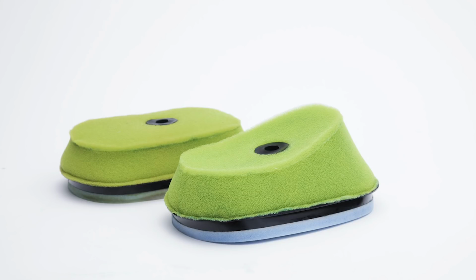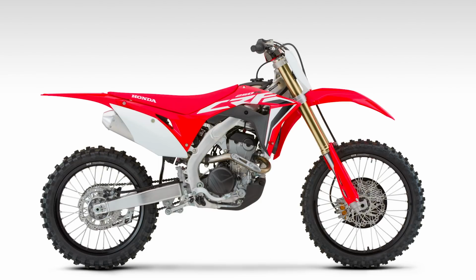They basically had a radiator that returned to the size that's on the right side. And since then, the Honda 250s have had a bit of cooling problems. I remember the first year, the intro we went to, they would just kind of puke coolant a little bit constantly. I know the race teams have struggled with that a little bit, keeping the bikes cool in outdoor nationals. So they've made some changes there to increase the overall size of that left side radiator.